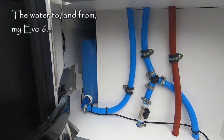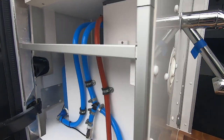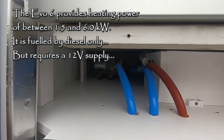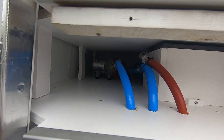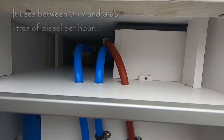Cold water is in the Fiamma 70 litre tank and filled from there. The pump up here pulls the water out, goes through a filter first, then through the pump, then through an accumulator, and then the cold water comes back down.